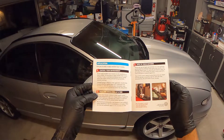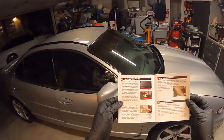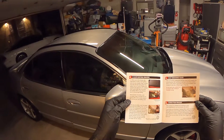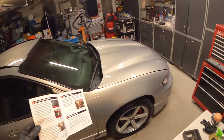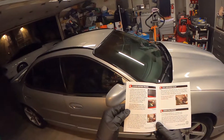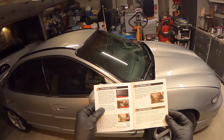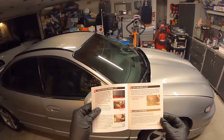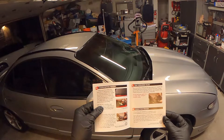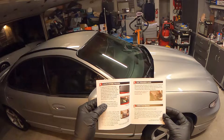Over-soaking can result in uneven application. This product is activated by air — keep the bottle tightly closed after dispensing to avoid immediate hardening. They say you have one to five minutes after application to start buffing your test area. For me it's around the four-minute mark before it's ready to wipe off. Then come back with the gray towel as your insurance towel. They recommend coating no more than three square feet at a time, and don't wash your vehicle for two to four hours after coating to facilitate curing.